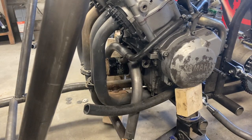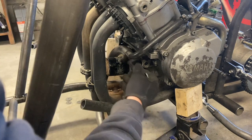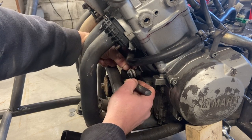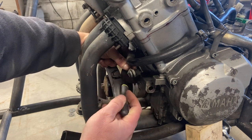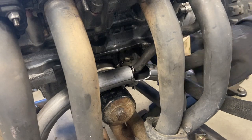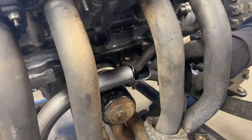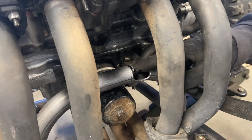This oil filter return line is turning out to be a big problem. The easiest solution would be to re-clock it in a different direction, but it doesn't look adjustable — it looks like one assembly. The decision is to go above it or below it. What we're going to do is notch the top half of this tube, take the notch we cut, flip it, and put it back in there and weld it. That makes a recess for the line to go out while keeping the full strength of the tubing. If I'd rotated the notch 30–45 degrees it would have changed the offset and cleared it — no problem.